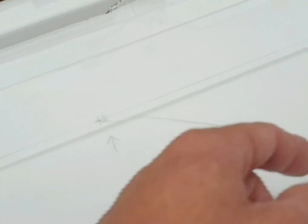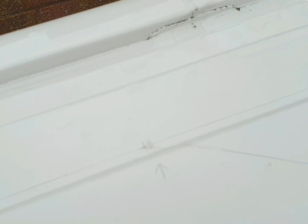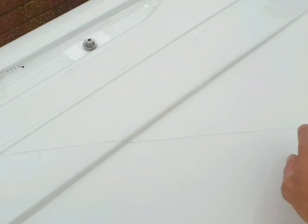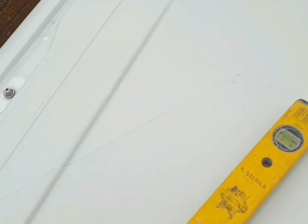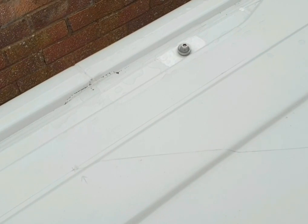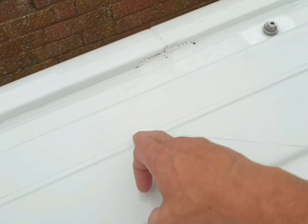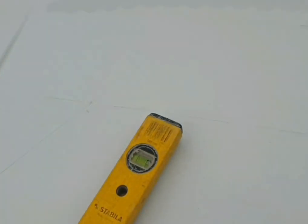And then, let's get to this point here. If you go past your line here, and then get your measurement from there to there, which is on the piece of fiberglass, to make that shape. I think the measurement was, I can't remember that. It's 480 mil. So get your tape on that edge at 480, swinging the tape round until it hits that point. As soon as it hits that line, that'll be your point. So this should be the right shape. We'll find out when we start cutting, which I'm going to start doing right now.